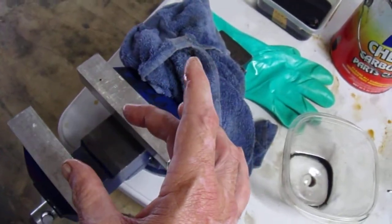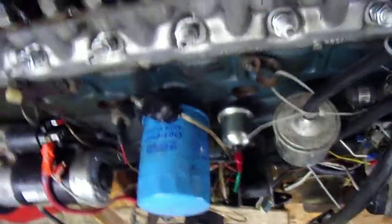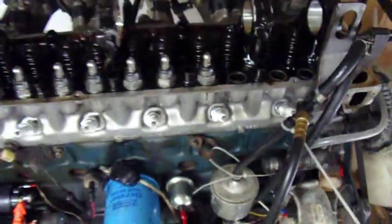That snap ring won't go in when you take it fresh out of the oil — you've got to bleed down the oil just a little bit. When you get it completely done, it'll be rock solid. All these are installed. I'll also clean out these pivot wells — get them all good and clean so it doesn't put fresh, dirty oil back in. Then I torque these back up to 62 foot-pounds and you're good to go.